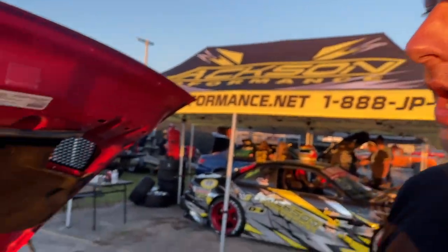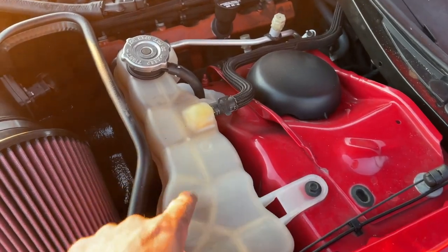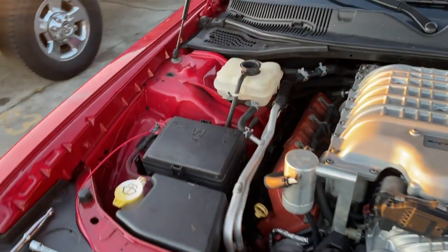I was back on the track going to make another hit, but the coolant temp and the intercooler temp water were super high — I'm talking like 230 for the coolant, and you can literally see it boiling. The intercooler is sitting at about 170 — it should be around 110. So Zach from Shop Hellcat is actually on his way up here. He's going to help me get this thing dialed. I'm a little bummed I couldn't rip it tonight, but this is how it goes when you're building a car to be reliable.